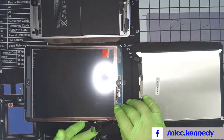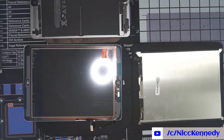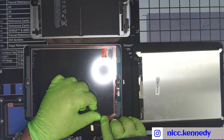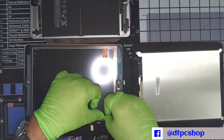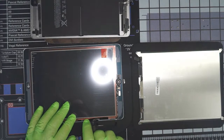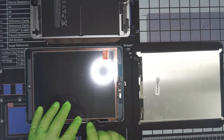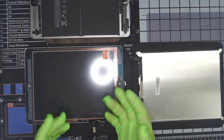Let's take a moment to do that. I'm going to fold it and then remove the adhesive, only after we have a pretty good fold on it. There's not a lot of room here, and it looks like it can run right out into view in your display without any problems. So fold your cable over, pre-fold it. Best advice. Like I said, I never did one of this gen. I don't remember doing an iPad where the cables came off the side, just the iPhones where it opened like a book.